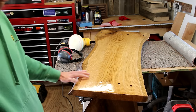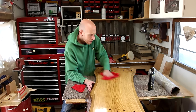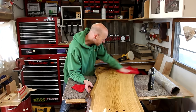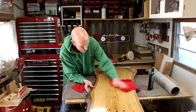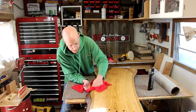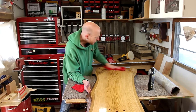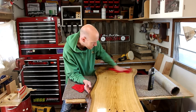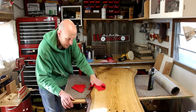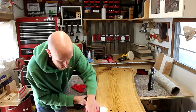Eventually, as you keep going, you'll see the shine start to come out — and that's when you know you're getting somewhere. Once you're all done polishing, take a good clean dry rag and just go through and kind of bring that final shine in by hand, because you're still going to have a little bit of that residue polishing compound left on there. Even though it looks nice and glossy, get in there with a rag and finish it up. You don't have to put a ton of elbow grease in it. You can feel on there where there's still some compound — you'll feel just a little bit of resistance. A couple of wipes with a rag in a circular motion, you'll feel that grit come off, the residue will go away, and you'll see that shine come right out.